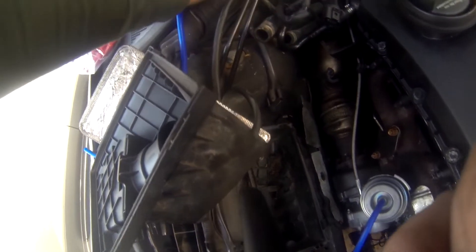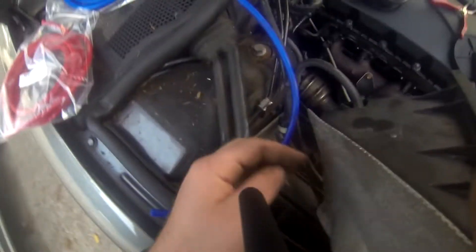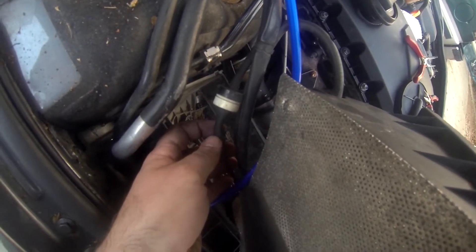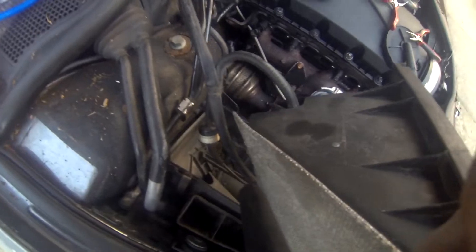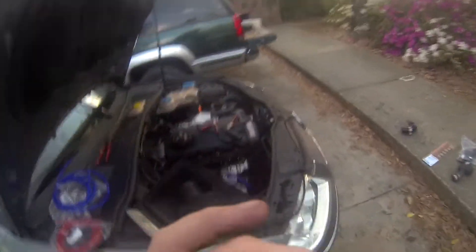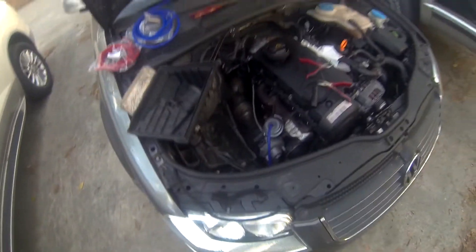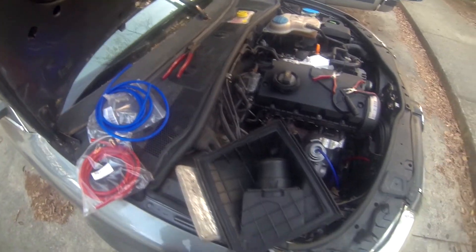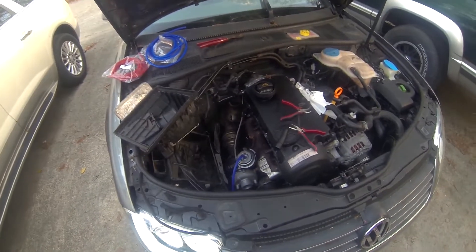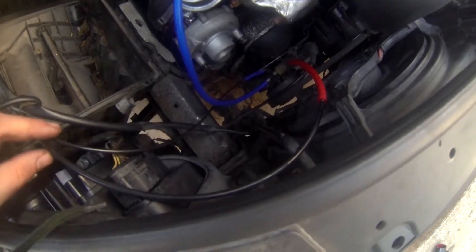Ideally your air box is out of the way — mine's being a little difficult. Anything that's got that same type of hose as you see right here, that's vacuum. I'm going to replace all this with this cool-looking silicone so that anytime somebody opens the hood of my pretty much normal-looking family car, they're going to be like 'what in the world is going on with all this red and blue?' I think I'm all custom, but really it's just good maintenance and an upgraded part. The silicone should last much longer than the braided rubber, and it's super cheap on Amazon — like 10 or 15 bucks for each pack — and now I've got 10 feet of each.